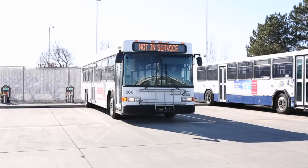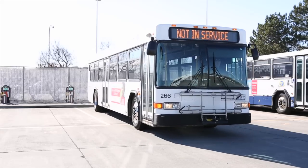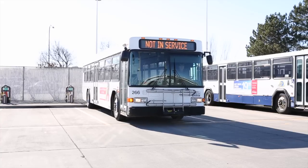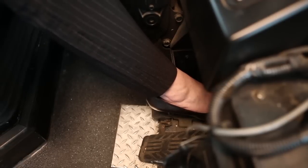Finally, you need to do the parking brake check. This requires that you drive the vehicle forward at about five miles per hour and activate the parking brake, or that you try to accelerate against the parking brake with the transmission in drive. The service brake check requires that the vehicle be driven forward, applying the service brake, and noting any pull to one side or the other.